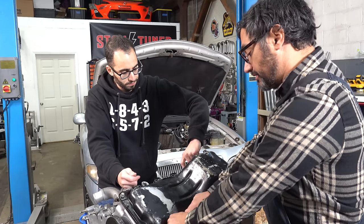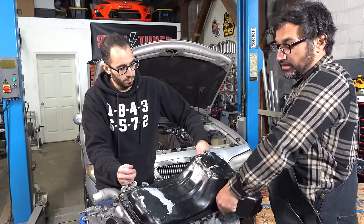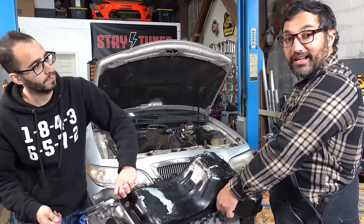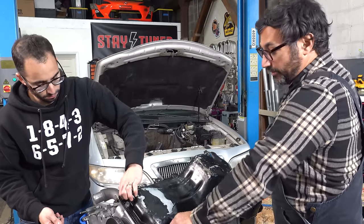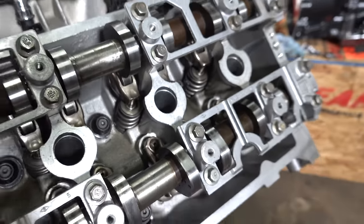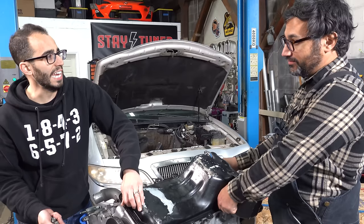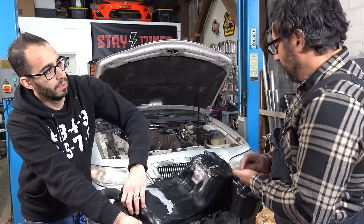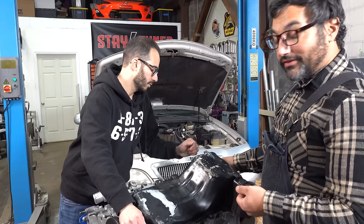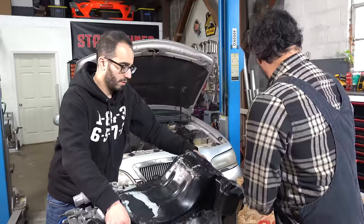But as I dug, he said, I don't have a ton of information on it, but here's what I've got. He sent me a piston card, cam cards. Oh, did I mention it has Bullet cams in it? Yeah. ARP, literally everything. So this thing is built to the hilt. But what's nice is I think he was wrong about the compression because I looked on the piston card and did the math myself, and I came up with this thing being like 8.8:1. And on the card, it says 8.9. Yeah, I just ballparked the thickness of the gasket and how far the pistons are in the hole and stuff. But essentially what we've got here is a boost motor ready for action. A killer stroker, a boost motor.